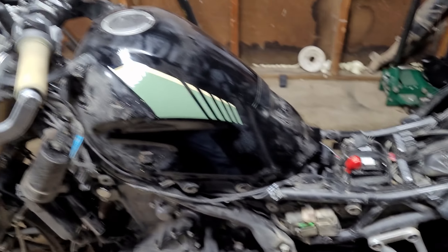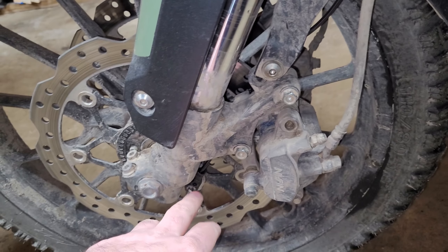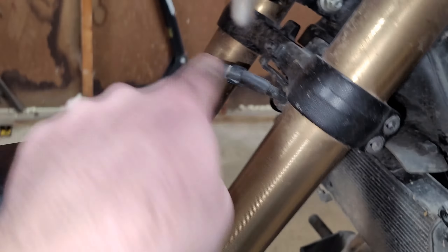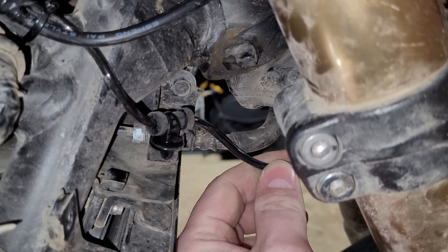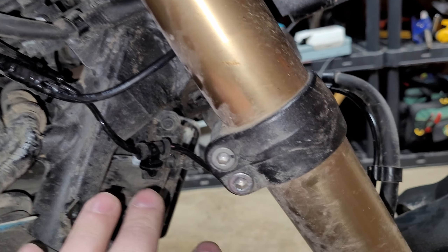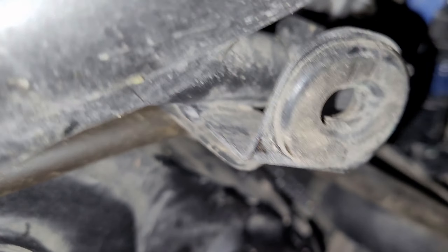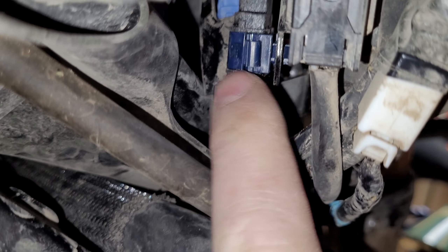The front sensor is easier to work with because the dashboard is closer. The ABS sensor is right here, held in with a single bolt, goes behind the tab on your forks where the brake caliper mounts, then follows the brake line up to right here. I did get a second ABS sensor — a factory replacement part — so I have the original OEM sensor on the shelf as a backup. This plug right here is the front ABS sensor plug, located behind the right side plastic.